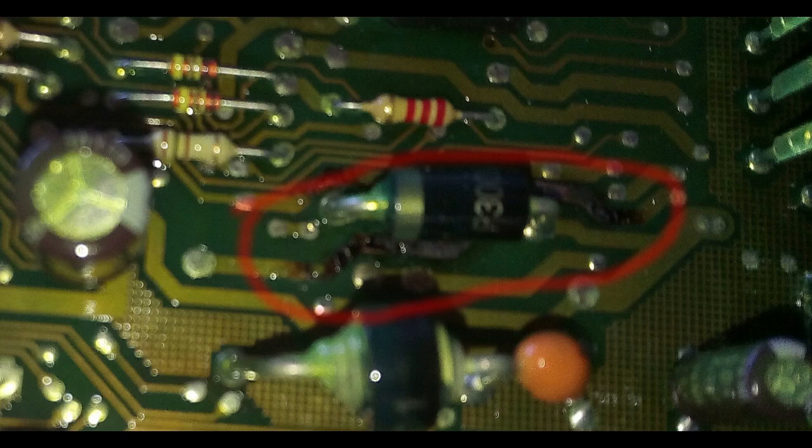You'll see the parts that I've outlined here. What it is — that circuit trace looks burnt. It actually looks like it's physically melted and come off the motherboard. Now, what that tends to suggest is that it's had high voltage, or high current, or some other power event come through it. Possibly a battery connected backwards, possibly a connector shorted out, that kind of thing. But this certainly tells us that our ECU is toast — it's been fried.